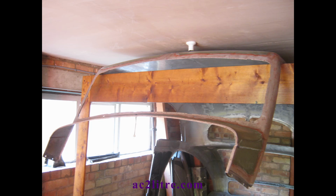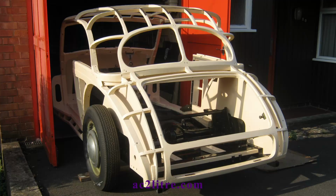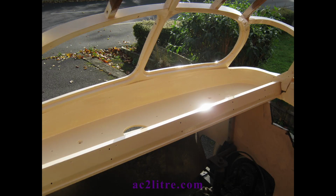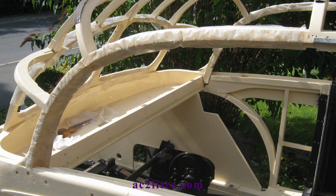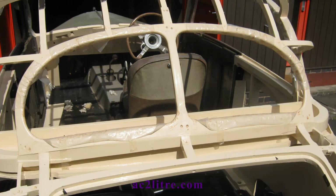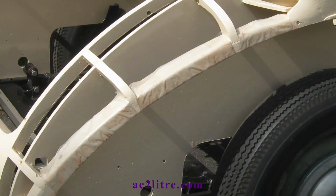Now I was ready for the final preparation for the shell to go back on. Having painted the wood frame, I did not want the edges of the panelling to scratch the paint off during refitting. Therefore, I wrapped parts of the frame in heavy-duty polythene sheets with clear wax oil underneath. I hoped this would make it easy to pull the sheets out once the shell was on. I also planned to use wax oil as a sealant all around the shell, as it would be very difficult to apply silicone sealant, which typically sets within 20 minutes.